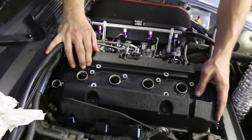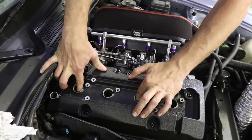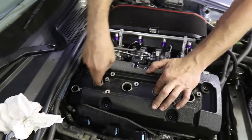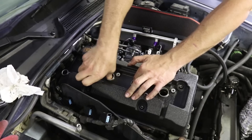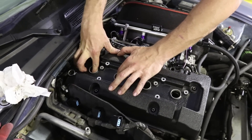Pro spec! You've got to be careful putting it on those spark plug tubes — don't nick those up. Just push them down and they seem to seat. They're a tight fit.